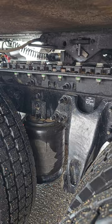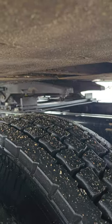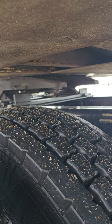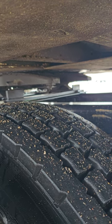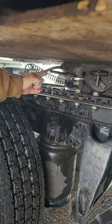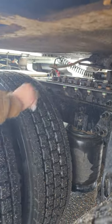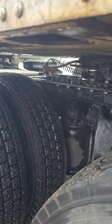My locking jaw is in there. It's around my kingpin. It's properly mounted, properly secured. This does not have a lever. My release arm is up here. It's properly mounted, properly secured. It's not cracked, bent, or broken, and it's in the locked position. This does not have a safety latch.